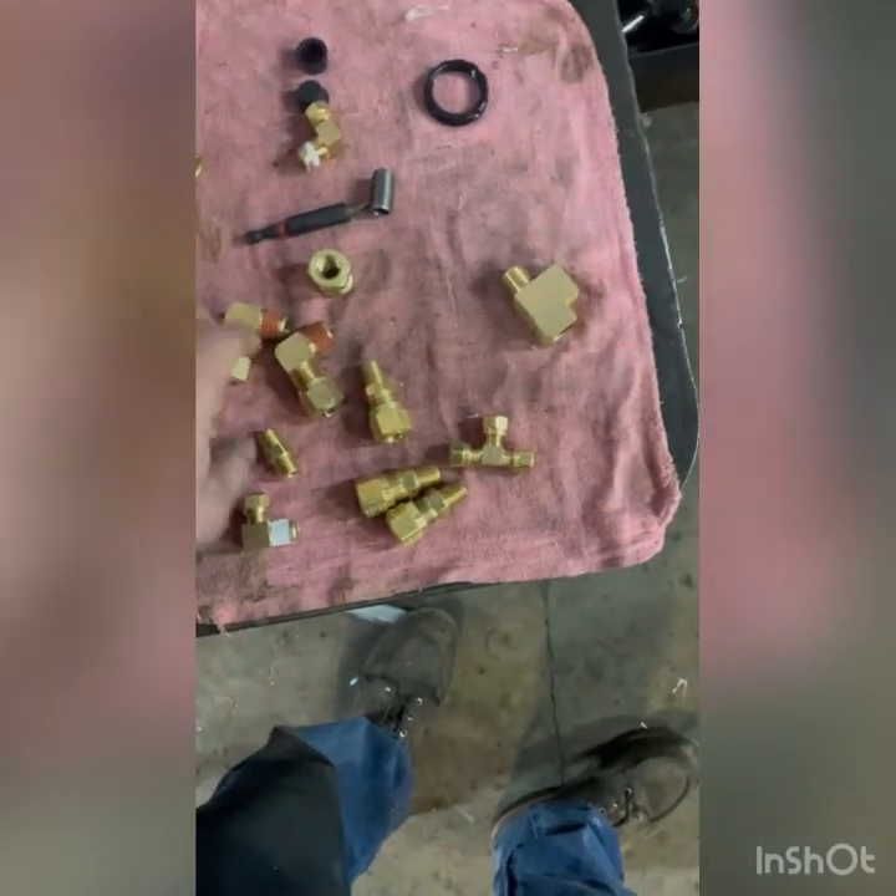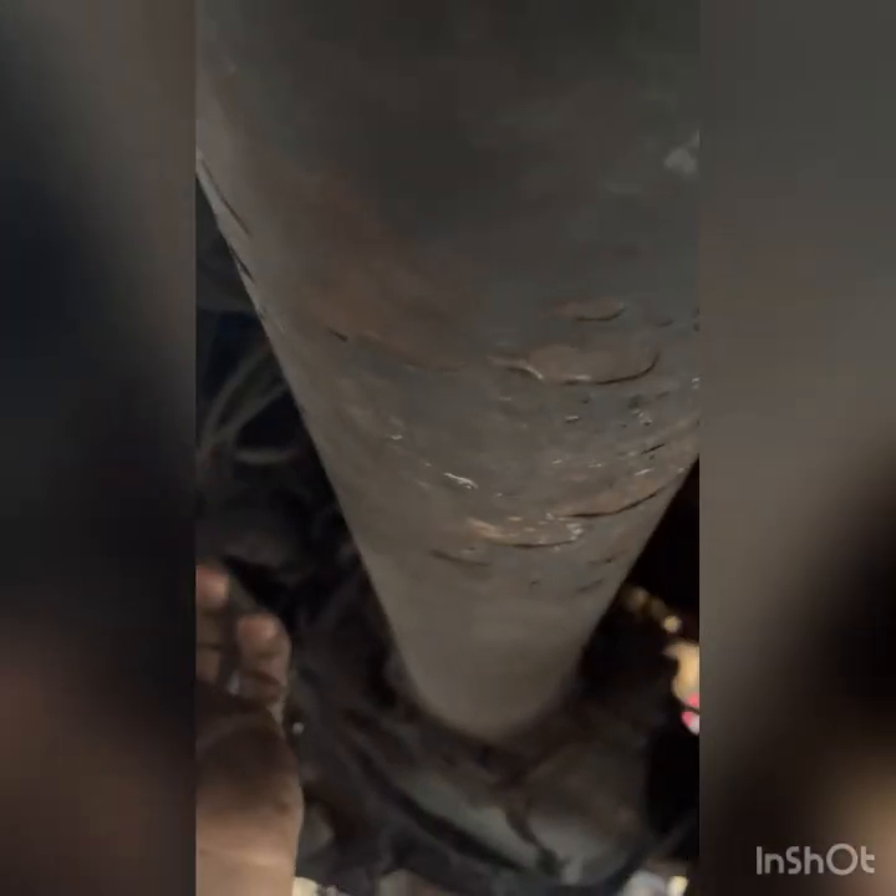Obviously not the tools, but all your elbows, air fittings, and everything you need comes in the kit. For our solenoid valve, we mounted it inside the frame to keep it all nice and clean, real close to our air tank. From there we'll run across for our inlet, then down the frame for the right airbag, and across and down for the left airbag.